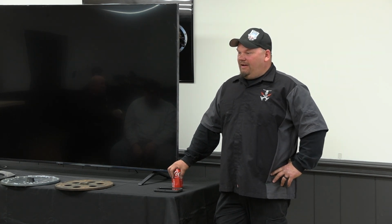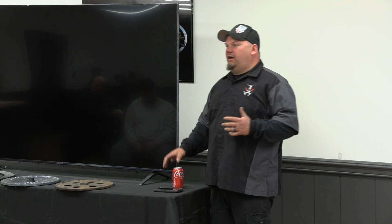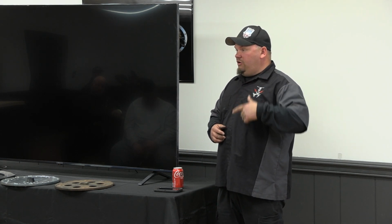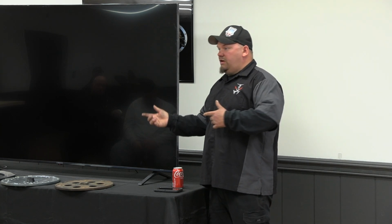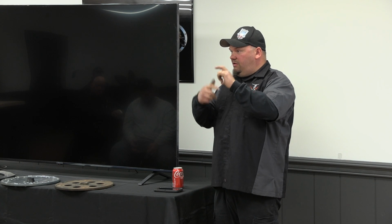Sorry. But yeah, to go from gas to E85, here's the thing with E85. It's great for somebody down south that doesn't use a lot of E85 at the gas station. They go get it at the pump, they can save money. If you're in an area where they seasonally change the blend, and you go from E85 and it's not 15%, it's 20, 25, 30, you have to tune accordingly, right? Or you're going to be too rich or too lean. So we sell them, we have them at the shop for the circle track guys, the little testers, right? You put the water in there and you shake it up and it'll tell you the percentage.